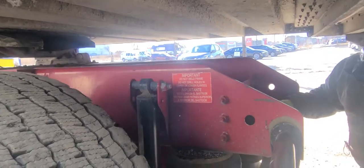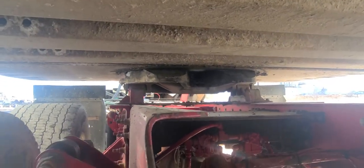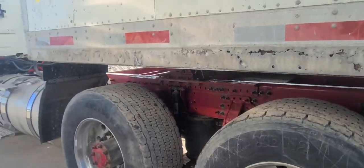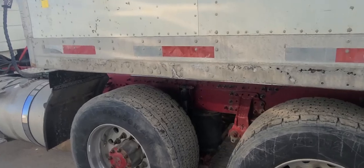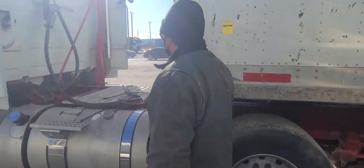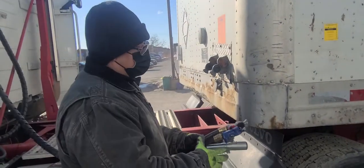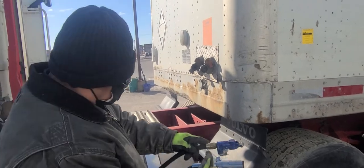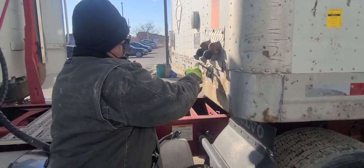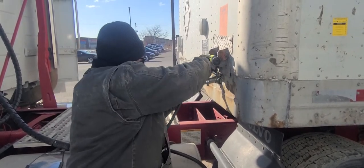Come underneath and now you see that the jaws are locked around the kingpin. Come outside again. Now you're gonna tell the examiner my jaws are locked on my kingpin. There is no sequence in which one you wanna hook up first. I like to do the electrical first. Make sure this clip here, lift this up, it goes straight like this. And it goes all over here. Straight.